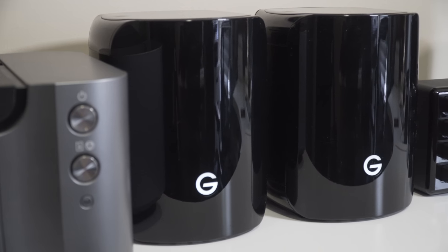When we first started we were using multiple individual hard drives - two or three that were backups of everything. Over the years the backup process grew and eventually we had like 10 to 15 external hard drives taking up all kinds of room with multiple USB cables and power supplies - a huge mess. So we switched to these G-Tech Studio enclosures where each one holds four different drives. That's where we keep our live work drive, Time Machine drive, final media drive, and all raw drive. The backup versions of those are in a second enclosure, while weekly and monthly backups live on external drives that can be swapped in and out and stored off-site or in the fireproof safe.